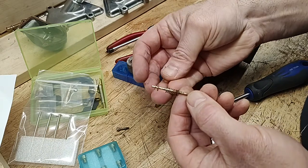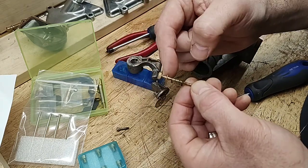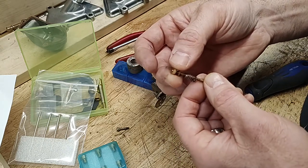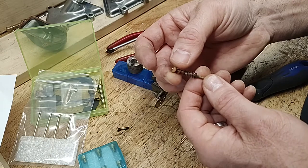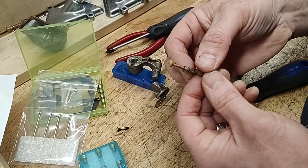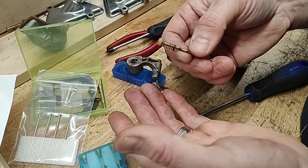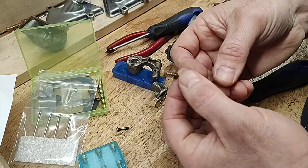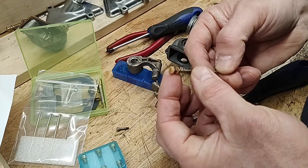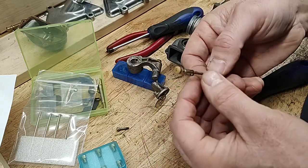Attached to the needle are a spacer and a spring seat. These appear to be made of nylon, and mine look okay, but it seems like these should be included in the kit, especially given the age of the original parts and the relative expense of including them. Being provided all these other needles to tune with, granted I haven't seen these available in my travels. They may be made of pure unobtainium, however, it'd be nice to see these included in the kit.